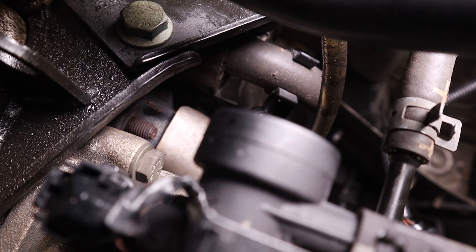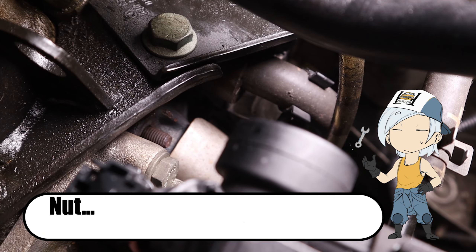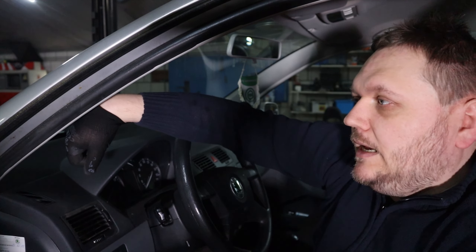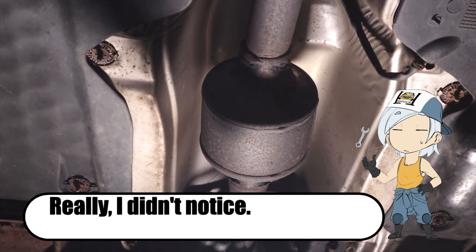The second oxygen sensor isn't getting its information when the car is squealing — that's because the exhaust is leaking. The catalytic converter on the inside is just kaput, and because of that it is blocking the exhaust gases going through the exhaust system. Because of that, the gas seeks the path of least resistance, which in this case is probably a gasket somewhere. I think it is the exhaust manifold gasket, because I also saw a nut missing — there's a bolt missing there, and that is where the leak is coming from.